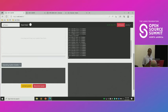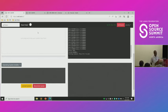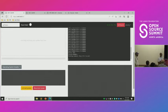That's a binary file — either 32 meg or 64 meg — and this is moving this binary into an FPGA which is faking the SPI flash part on the motherboard. That FPGA is directly connected to the DL360 motherboard or the DL325 motherboard. When we turn on the power, the chipset is going to load the firmware directly from that FPGA. That means we do not need to remove the SPI flash, put it into a programmer, and put it back into the server.